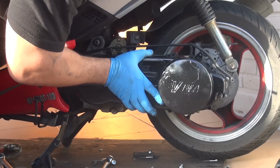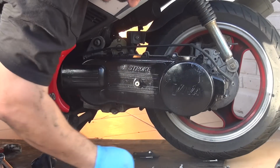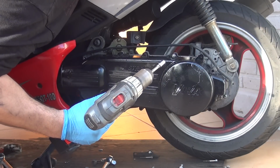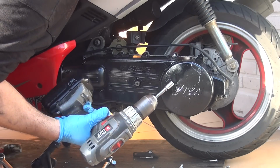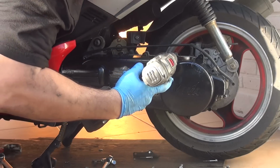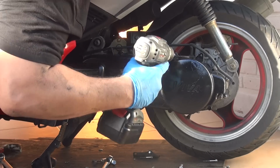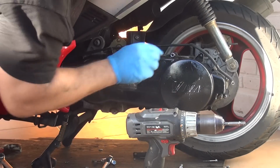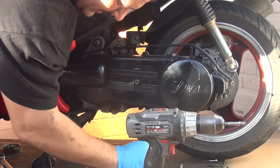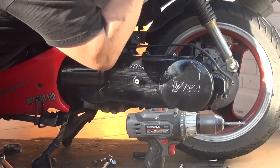Make sure all the holes are matching. Now remember, for the screws, you're going to need a socket wrench that is a 5/16 socket wrench. Now be gentle and be careful when you tighten the crankcase again, because the crankcase and the screws and the place where they attach is fragile. So being fragile, be careful. You don't want to break your crankcase.